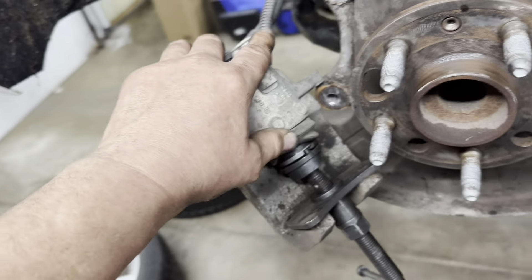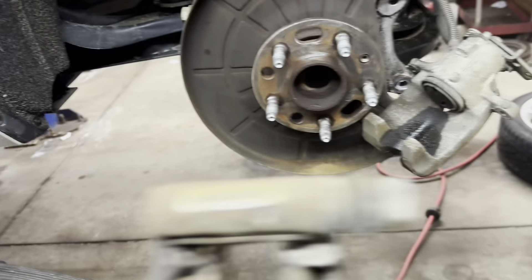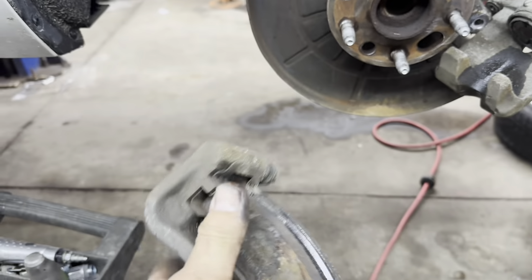I need to make sure the piston is not frozen before I go to the parts store — I don't want to take two trips. My caliper bracket came out really hard, and my rotor was stuck on there so I had to hit it really hard. Got the hub cleaned up, got the piston pushed back in — it didn't go any harder than the other side, just needed silicone spray to keep the boot from twisting. It must have been those pads frozen in the bracket.